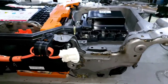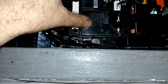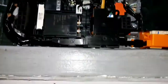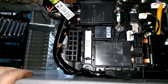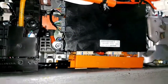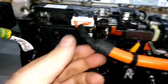Looking at the battery from a different perspective — this is the battery junction block. These are the two main contactors, this is the pre-charge contactor, and this is the main fuse. These small relays are fed from the low voltage side to activate the high voltage relays. Here's the low voltage connector coming from the rest of the vehicle. This component is the battery management unit, which monitors each cell and balances the voltage between them to keep all voltages equal.